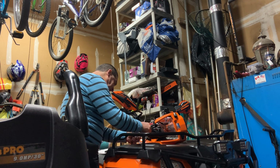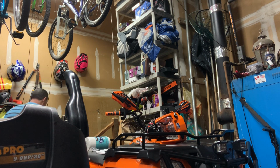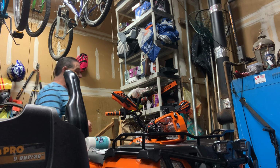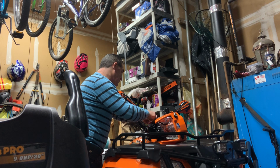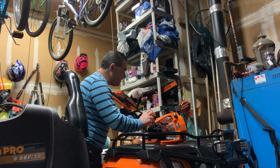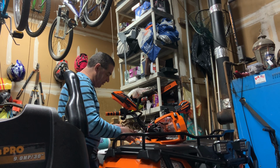And you know, it wasn't a bad kit. I would like to put a little piece of tape around one thing in there. When you're working on these quads, I like Scotch 88, mainly because you're working with something that could be out in cold weather. 33 is great too, but do not be dealing with the cheap Chinese tape. Don't even waste your time with that stuff. It's not stretchable, it's not pliable, it's not good in cold weather.